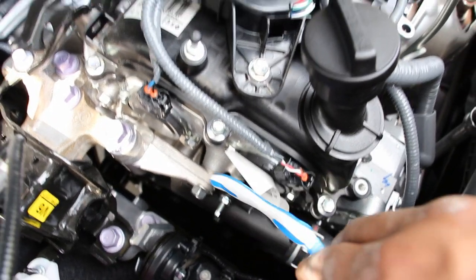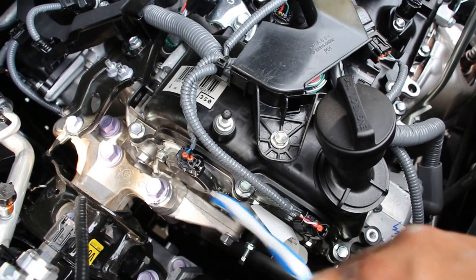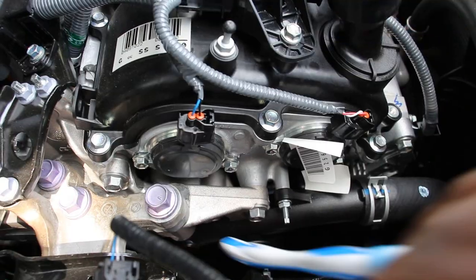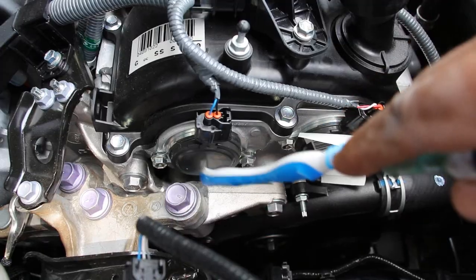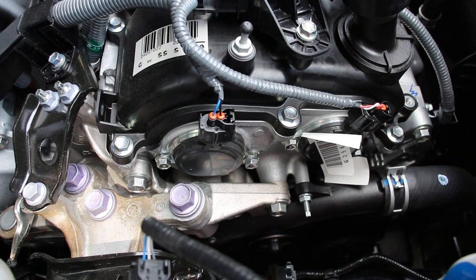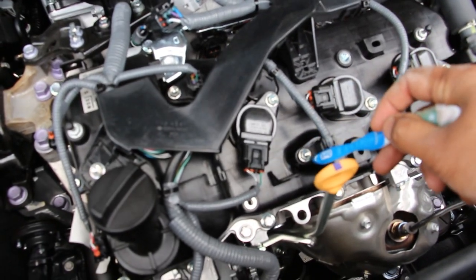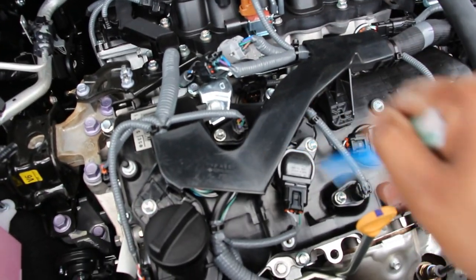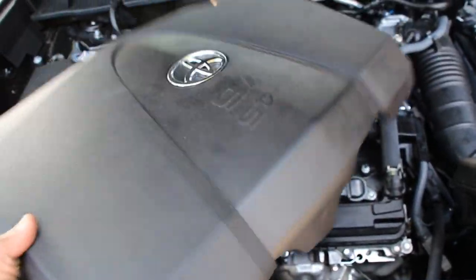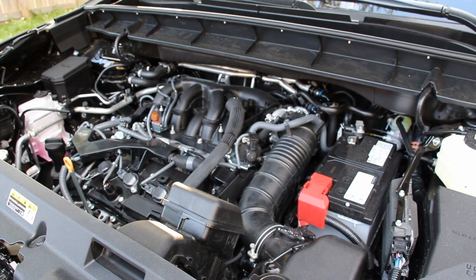More importantly, just behind the drive belt setup is your timing chain setup. This has a timing chain which means you don't typically need to service this over the life of the engine. Those timing chains are going to drive both the intake and exhaust camshafts on the front head as well as on the back head. These here are the oil control valves that power the variable valve timing gear for both the intake and exhaust side. We also have your variable valve timing sensors on top of the bank here as well as the set at the back so the computer knows exactly where those camshafts are. These engine covers aren't even plastic anymore — it's all just made of sound deadening foam. And now we'll have a listen to the engine.